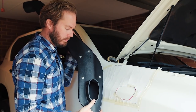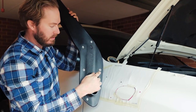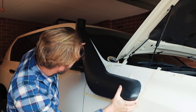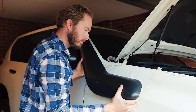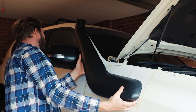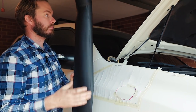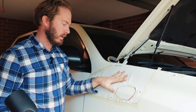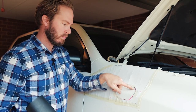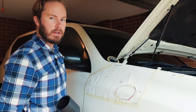There's the big oval shape — that's where our hole's going to be. You can see all the spots where the studs will go. Looks pretty right. Now we'll take that off, get the centre punch and punch out these holes for drilling, punch out one on the oval here so we can use the air body saw, and we'll hit the point of no return.